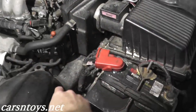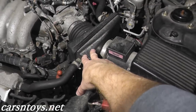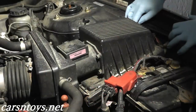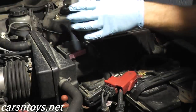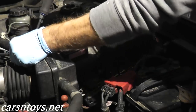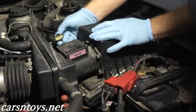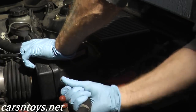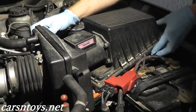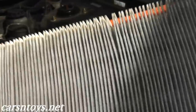The air intake sensor in this vehicle lives in a plastic tube toward the rear. To get to it, I'm going to remove the air box along with this plastic housing, just to get a clear picture of where the sensor is located. We'll undo the clips, move the hose clamps — there are two on this vehicle — and undo the mass air flow sensor connector. If your air filter is dirty, now is a good time to replace it.